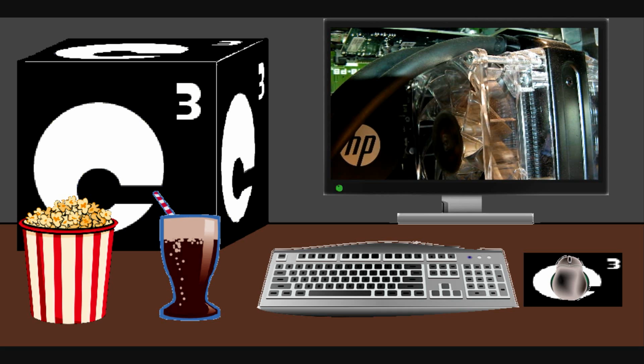With water cooling systems, you can run the risk of springing a leak, and that coolant, in many cases, will conduct. And if it leaks out onto your hardware components, it can trash the motherboard or whatever else that coolant makes contact with. Also, if you lose enough coolant, you could risk overheating the system, and if that coolant contains ethylene glycol, like what's in your automotive antifreeze, it is poisonous to humans and animals. So if it leaks out of your system and your dog or cat drinks it, it can poison them. Or if your little kid happens to sip it up, it can poison them. There's just so many things that can go on here.